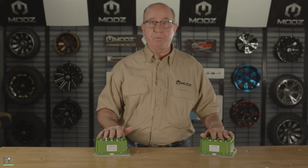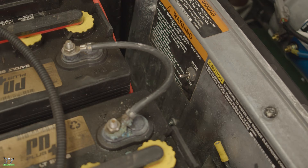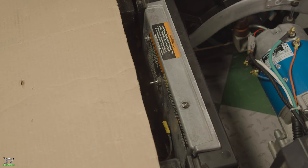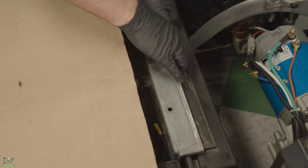We've taken the body off of this car so you can actually see what we're doing. Let's go ahead and get started. We'll put the car into tow, then remove a battery terminal. Remove this bolt using our T40 Torx bit. Now with a piece of cardboard here to protect this from the batteries, we will pull back and lift up.